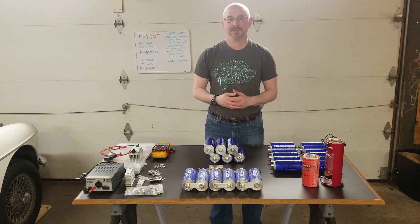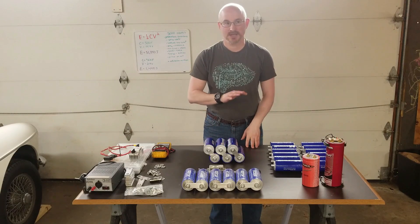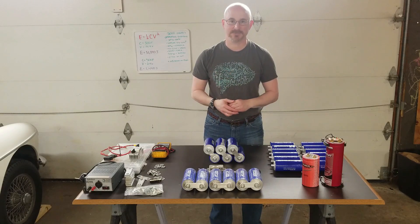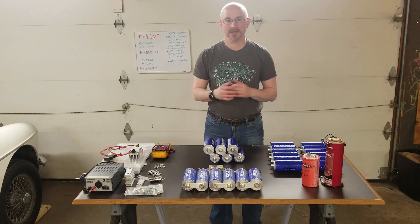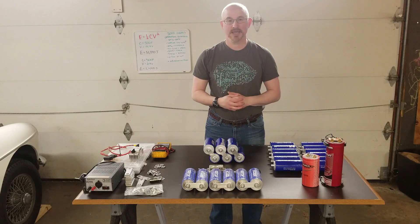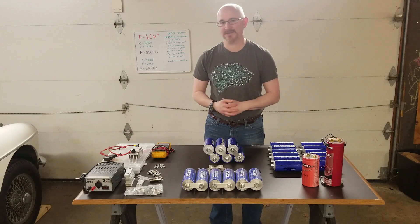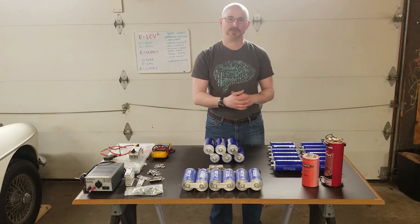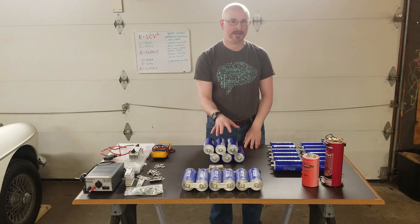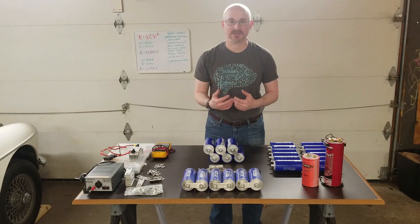My current system is a 2014 Accord with a stock alternator. Even with a stock battery, running these ultracapacitors while driving I had no problems whatsoever — excellent voltage regulation with a pretty decent size system. Once I wanted to listen with the car off for longer periods for competition, I upgraded the stock battery to an AGM group 34 instead of the 51 that was in there, increasing battery capacity but maintaining the ultracapacitors so the stock alternator isn't solely responsible for fast transient music.